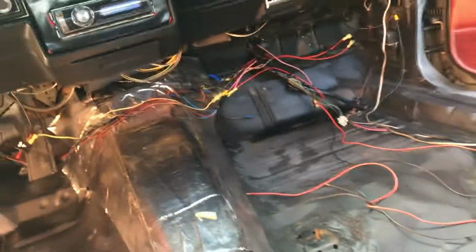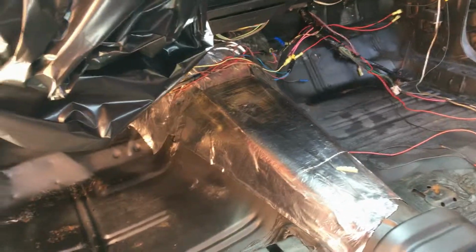I'm in California here, and these spots right here, I kind of just was testing it to see how the stuff worked. Like this whole floor looks like it's been cleaned up and painted. This was just new rust spots just due to water sitting under the carpet somehow for however long it's been there. So I probably should wire brush that off to do it more professionally, and I probably will, but I just wanted to see what it looked like when I hit it up without doing anything to it. So yeah, I would just wire brush it a little bit and then hit it up again probably. That's probably what I'm gonna do.